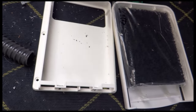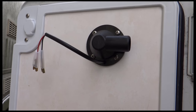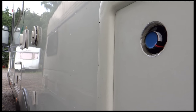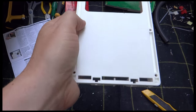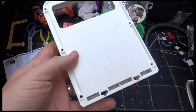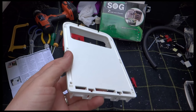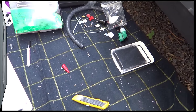and then I get on to mounting the external cover for it. Okay, that's the fan screwed on. See, it's pointing towards the hinge as it says. And the outside bit, I was waiting for the window up here. Cover to go on, so it says for this that you need to pop a bit of silicone on the inside of it to seal it, so I'm just going to do that around the edge here, and then I'll screw that on, and I'll come back and put the charcoal filter in and put the front on.